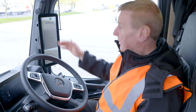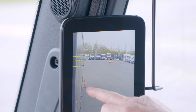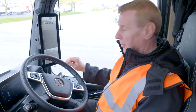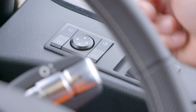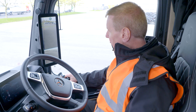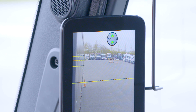I've set the cone at the rearmost area of the trailer. Now what we've got to do is align this line here with the cone. To do that we've got to activate the right-hand button for the right-hand mirror, and then use the direction area to align it so it's in the middle of the cone.